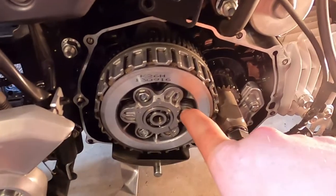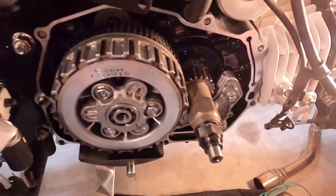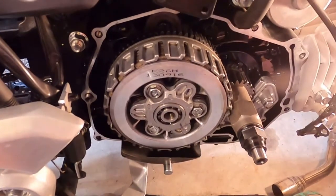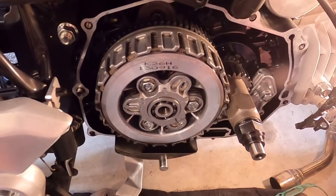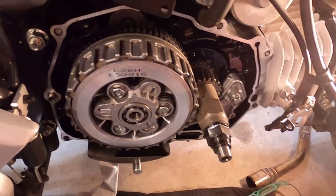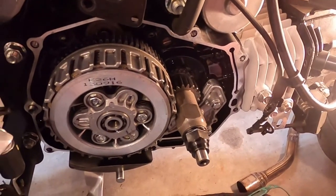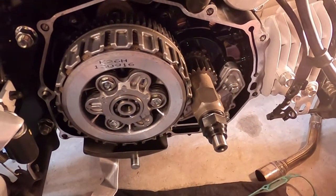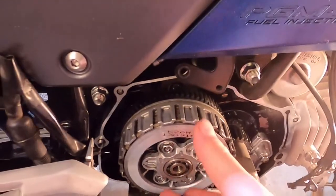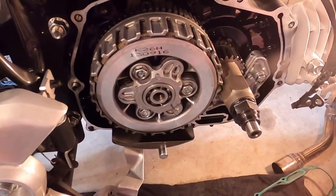So where we're at, these three bolts go in. About 9 foot-pounds is what I put them at. Be sure that you're either using the proper size torque wrench, or making sure that your 3/8, which is what mine is, is pretty calibrated, so you don't wring these out, because you're going to have way too much arm for these little bolts. So this literally lines up like Legos to go in there, and that's all back in.